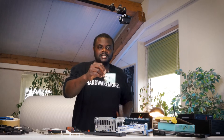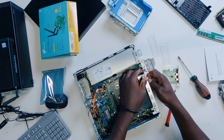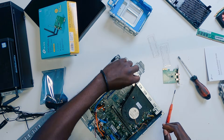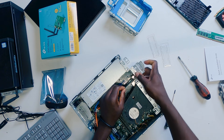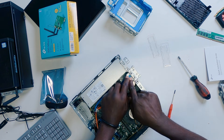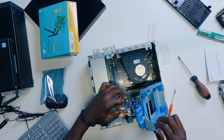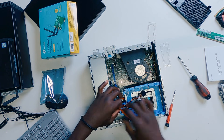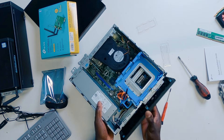So if you've done that it should look exactly something like this. I'm going to put the wireless LAN card on the PCI slot, but the problem is on this PC the bracket here is still blocked onto the chassis. So what I have to do is carefully break it loose — just keep twisting it around and then you have it. Thereafter, my wireless LAN card comes into place. You always have to be gentle whenever you do upgrades on a PC. Now the HD caddy comes back, make sure it's closed, and ensure the cables are well managed.